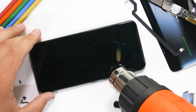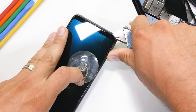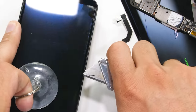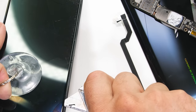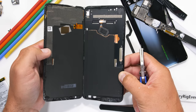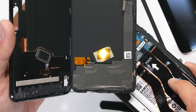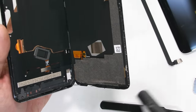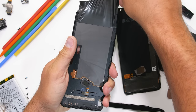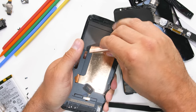Now for the screen. I'll use a little heat to help my razor get between the screen and the frame, then a little brute force to finish off the separation. The surface of the glass is still intact, but the super fragile AMOLED screen underneath is not. Either way, mission accomplished. The screen folds open like a book and we get our first look at the flat, non-camera-lens, first-generation style fingerprint reader — rather large, but it didn't end up working out very well. I'll peel off the layer of black tape, and underneath that is more copper tape covering the largest copper vapor chamber we've ever seen in a cell phone.